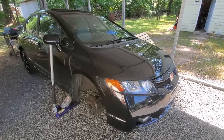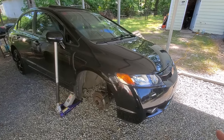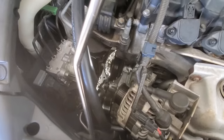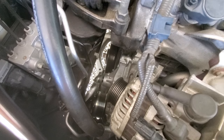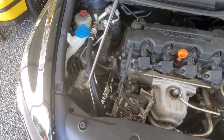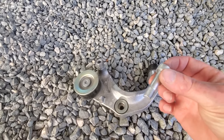This has been a really good car — it's really just had basic maintenance, but now it has a major problem: it has a bolt broke off in the block. Looking underneath the hood here, you can see I've already started doing some work. I have the alternator removed, the water pump pulley removed, our belt, and the belt tensioner removed. On these 2006 to 2011 Honda Civics, they have a pivot bolt for the belt tensioner which can and will break off into the block, and that is exactly what has happened to this car. Here's the belt tensioner assembly and here is our broken bolt.